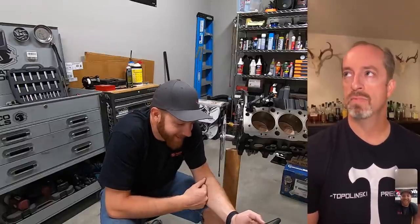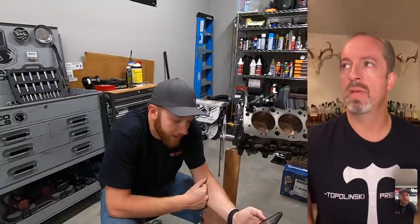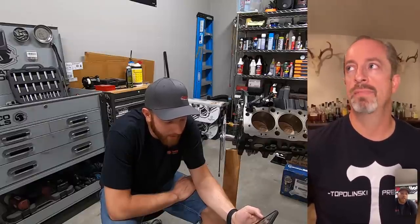Boy, I'm kind of running the numbers on that one. You are going to have to stand on this thing hard. You say you have a power goal of 1500, right? 1500, yeah. Okay, so that's probably one atmosphere boost. I was kind of figuring like 15 to 20 pounds is what we'd have to push through this. Well, the difference between 15 and 20 there, that's not a linear curve. Keep that in mind, right? So, 20 pounds will do it. At 20 psi, that engine will be 1750.